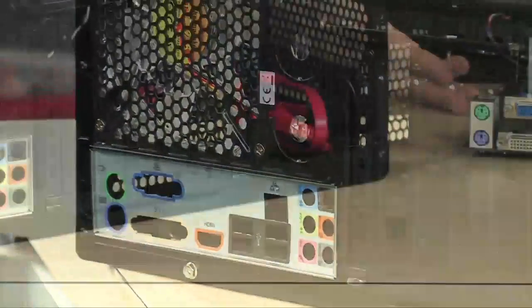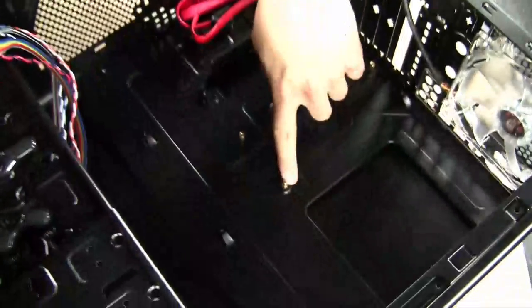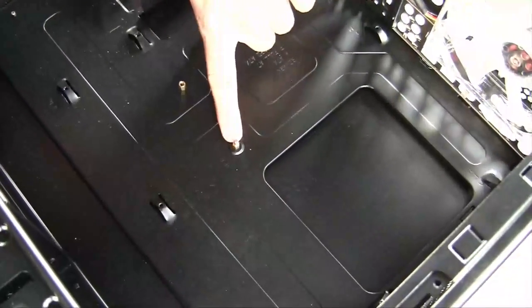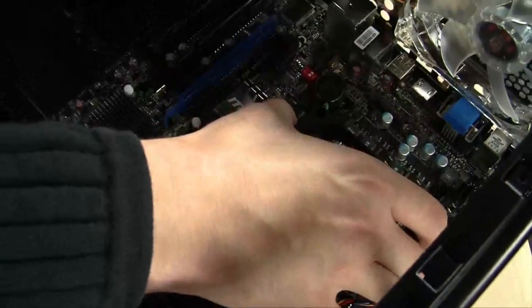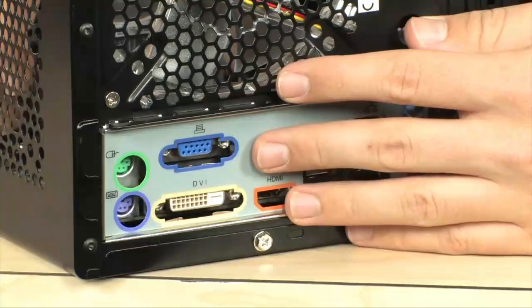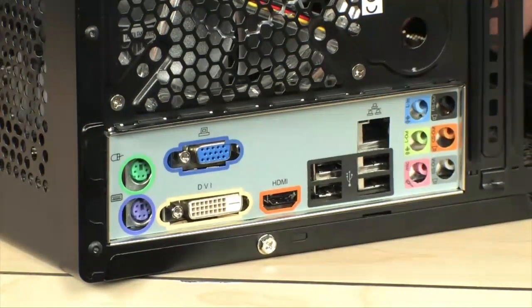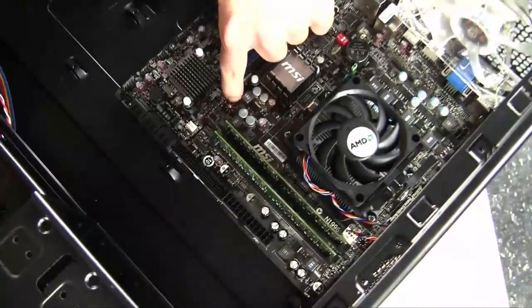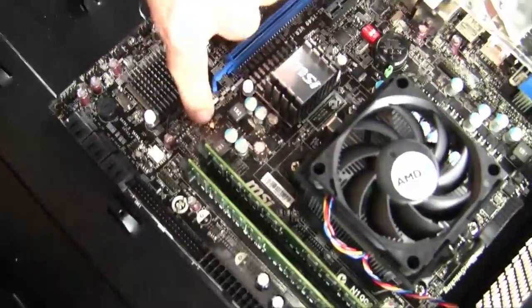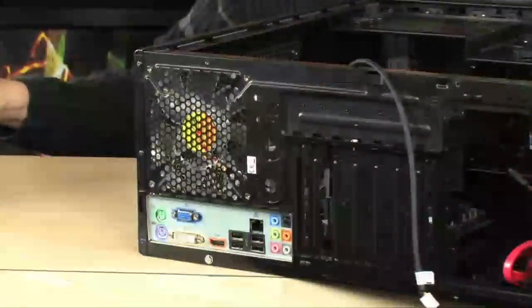Here goes the motherboard. This motherboard has a singular post already put in for you — it's not a screw, just a post that lines up the rest so it's easy to put the screws in. Line it up with the input-output shield and push it in until it hits that post. Once that post goes through, everything else is lined up and you can put all your screws in really easily.